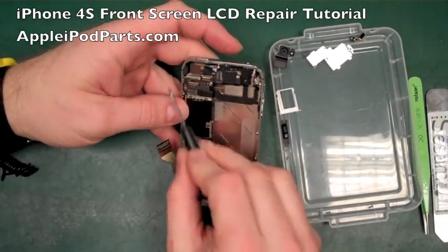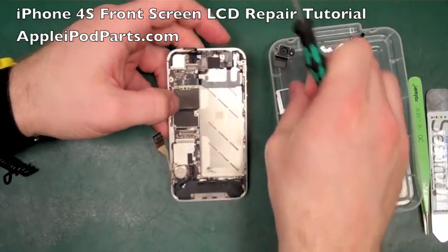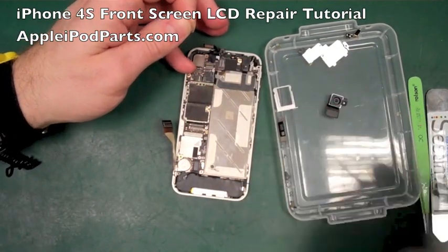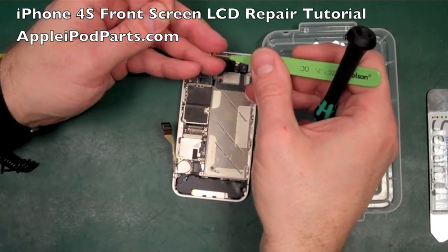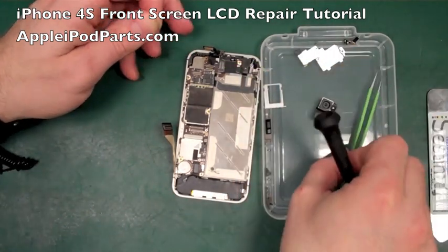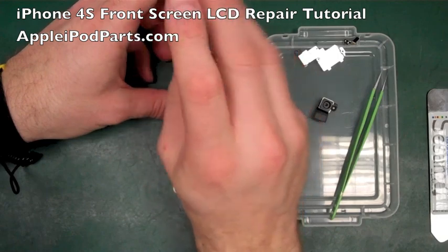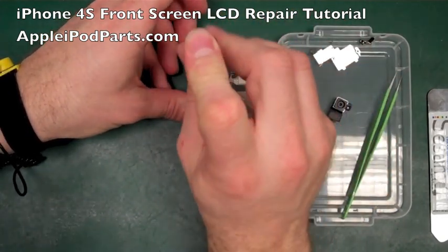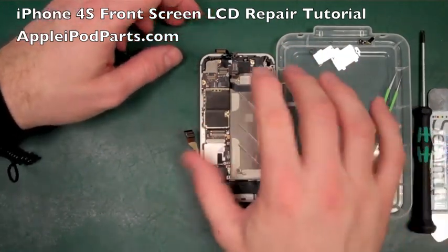Right, so the board's going together. There's that little screw at the top. We were trying not to forget, weren't we? It's actually stuck to the camera there, and that gold bracket. Now, if you remember which way I said that goes, it goes like so. Lay it in there gently, and then come in with the screw. And then just tighten it up, and that bracket almost finds its own home. So there's the two tongs.